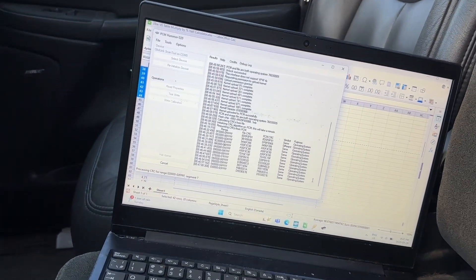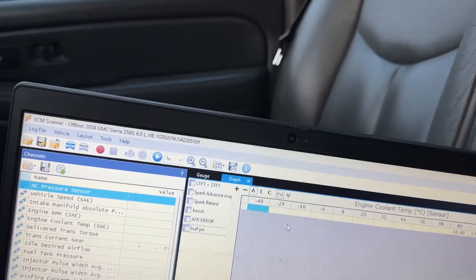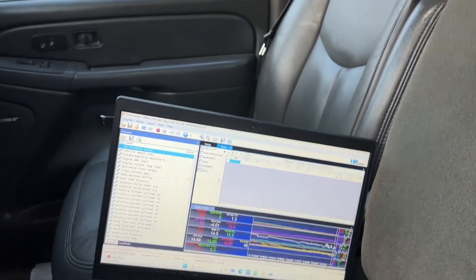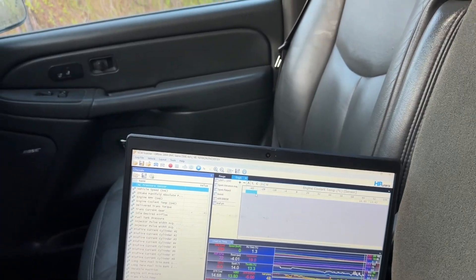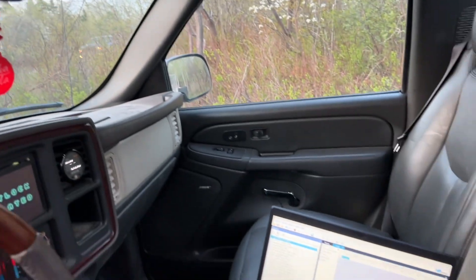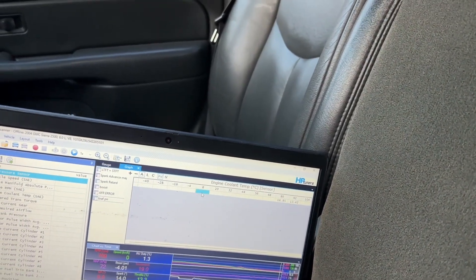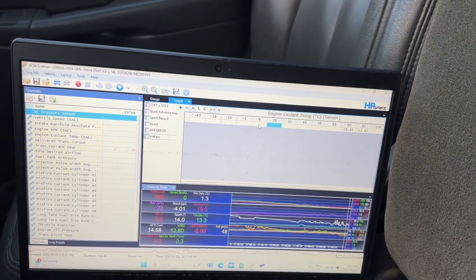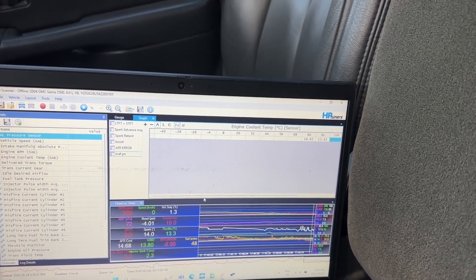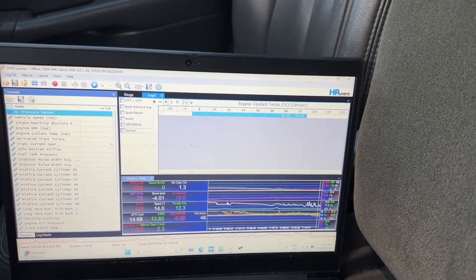When I get this tune written in, I'm going to jump over to VCM Scanner and go over to BRAF. Now this says park neutral, but it's the same chart — I just put it in drive or park and log it from there. What I'm going to do right now is in drive, because park neutral is actually not that bad. I'm not exactly sure what the temperature is — it's 18 degrees Celsius, whatever that is in Fahrenheit, because it's been shut off for three or four hours. This is in Celsius, so it's either going to start in the 8 cell or the 20 cell and collect data, populating these cells all the way up to probably 92 or 104 degrees. Then I'll take that data and put it into the base running airflow in the tune.